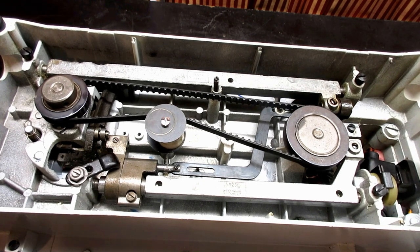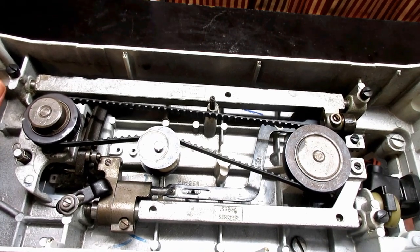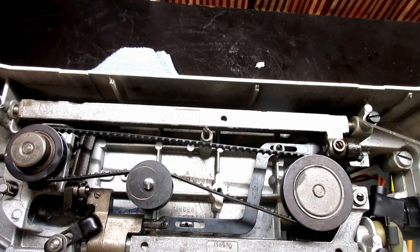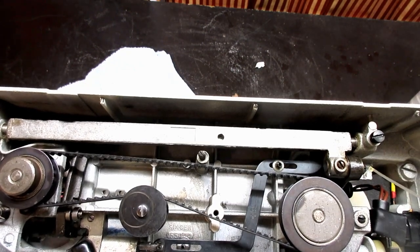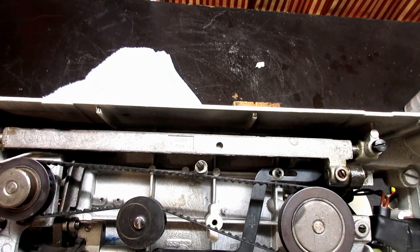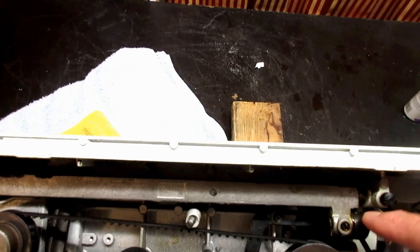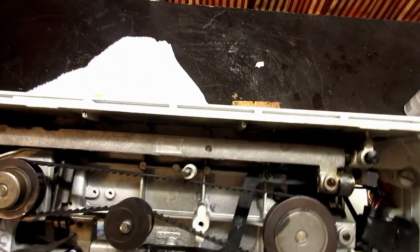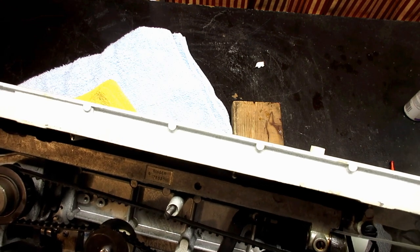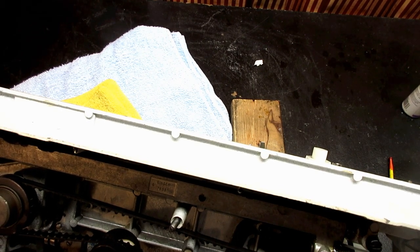And there's, let me think, 1, 2, 3, 4, 5, 6, 7, 8. Kind of four on each side here. And the first one is up here at the little bushing right here. See that showing up? Yeah, right there. And then in this housing with the adjustment screw, there is a little hole on the top of that. And we know that that is to put oil in there. In the hole, give it a squeeze.